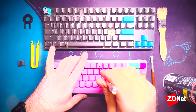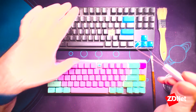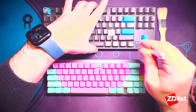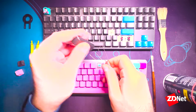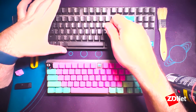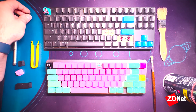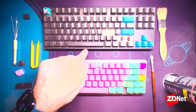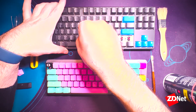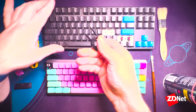Same thing on the Alt — slide it around the sides, pivot it to the corners, lift and it should pop off. With longer keys you can slide it around one corner and then work it over to the other corner and it will lift the whole key at once. If you want to use the plastic keycap puller, those go down over the key, you hear a click when it seats into place, and then you just lift and it comes off. The problem is the thicker legs can be problematic with recessed switches — it may only click in on one side. That and the fact that they could scratch your keys are the reasons why we don't generally recommend using this type.